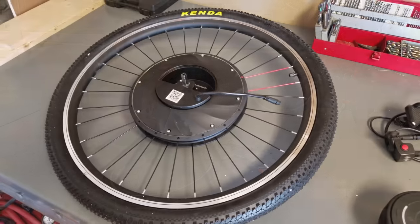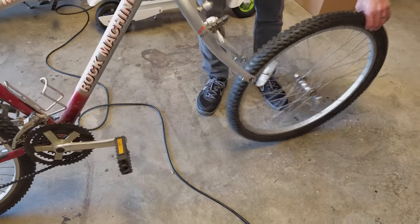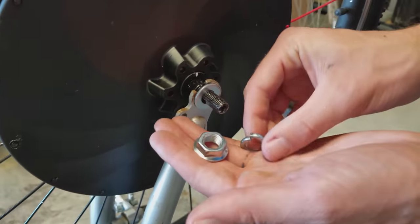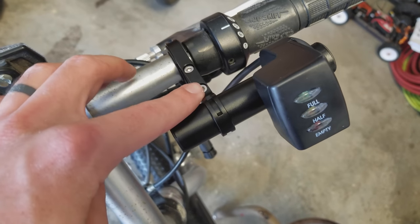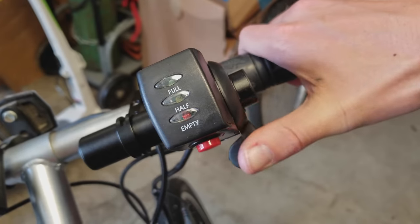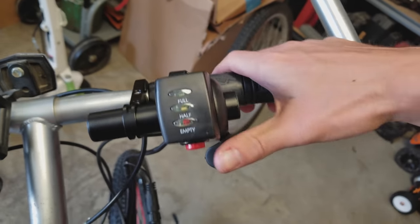Let's go into the shop and install it. The kit includes everything you need, even the tools, which is nice. Assembly is easy: remove your old front tire, drop in your new e-tire, throw on some washers and tighten it down. Attach the cell phone holder and the throttle controller. Since my gear shifter was kind of in the way, they fortunately include spare parts like this extending rod, which allowed me to get perfectly aligned with my thumb so I can still hit the throttle and change gears when I need to.